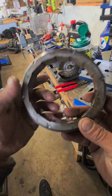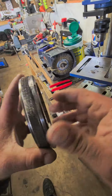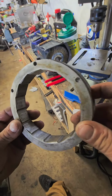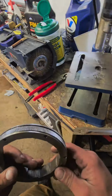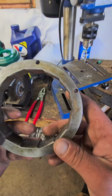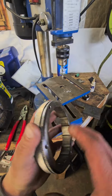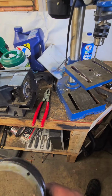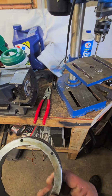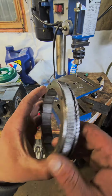And then I'm gonna get these other 3 drilled, and then I guess I'll get a little bit of me tapping them if you don't know how to tap holes. But tapping is the more time-consuming part, because for some reason it's just a pain in the ass to tap these. If you're rushing through it, you're gonna go through a few taps. I suggest getting a quality tap, get a couple of them, and just take your time. 1/4 by 28 is what we're tapping the holes to.